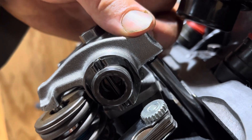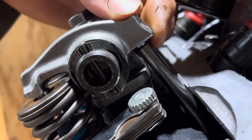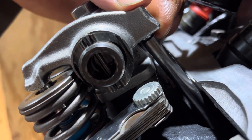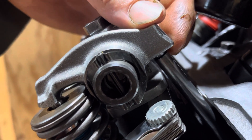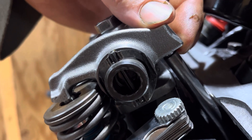You can see if I push down hard enough, the pushrod goes down a small amount. When it's fully up, I have a 25 thousandths shim in there and it still has a little play.